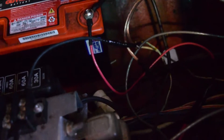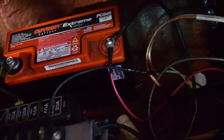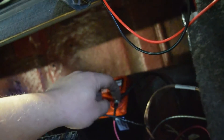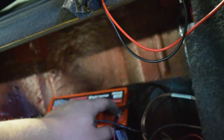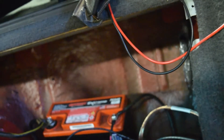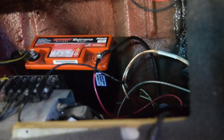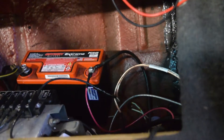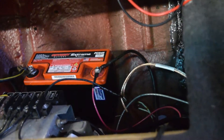It's a very simple way to wire it in — the easiest way to do it. The only thing I'd recommend is to be really careful, because it's wired to constant 12-volt battery power instead of ignition. Somebody could turn it on and leave it on by accident, so you'd have to make sure to always turn it off when you leave the car. I'll throw up some pictures and diagrams if I can make them simple enough to read.